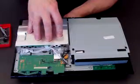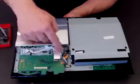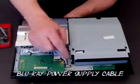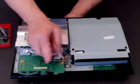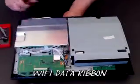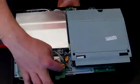If you have a black PSU it'll have a three-core cable here, and it should be around about the same length. This black and gray cable here is the power supply for your Blu-ray, and these also come in long and short versions — the early ones being short, from the C model onward, and the later ones being longer. This is the data ribbon for your Blu-ray. At the back here there's an aerial wire that goes from your Wi-Fi Bluetooth circuit board and runs up through here to the little aerial at the back.